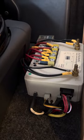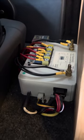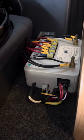Under this little cover we've got this box here, which is essentially the brains for your control panel — almost like a power supply unit. Looks a lot more complicated than it actually is. Leave that covered up so you don't accidentally touch any of it. There are a couple of fuses down there as well — if you do have any problems with anything electrical, it's more than likely going to be a fuse down there. These lights here are mains powered, so if you're wondering why they're not working it's because they need mains hookup, and I believe they're touch-sensitive ones.